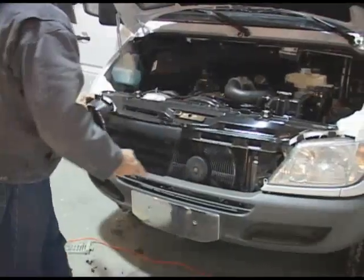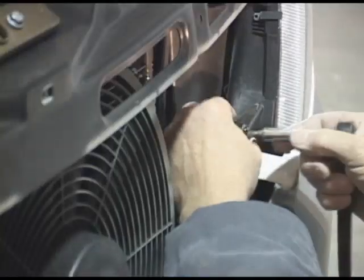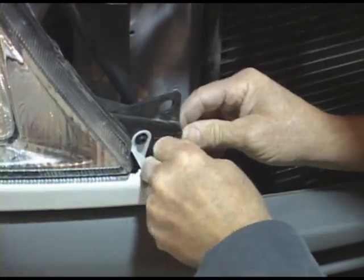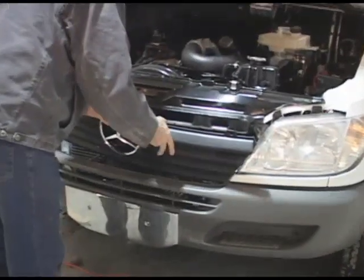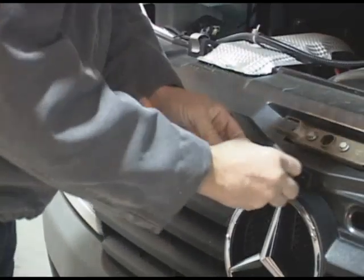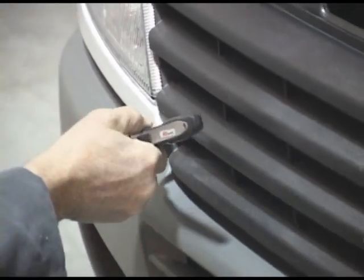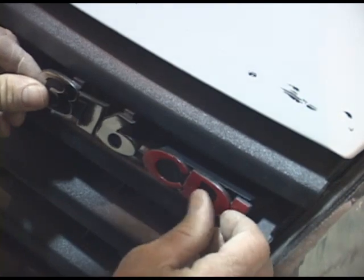In order to install most Mercedes grills you will need to move the lower mounting clips down to their bottom position. Check the fit of your new grill to see if this is necessary. Remove the lower mounting screws and move the clip to the bottom position. Reinstall the screws but do not tighten. Install the new grill by sliding the bottom two holes over the lower mounting screws. Reinstall the top mounting screw and the two plastic plugs removed earlier. Tighten the two lower mounting screws. The grill name plate is installed by aligning the tabs with the holes provided on the grill and pressing into place.